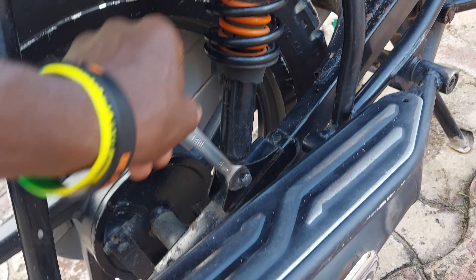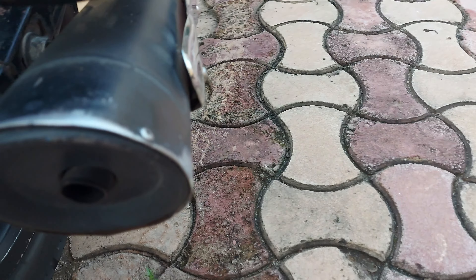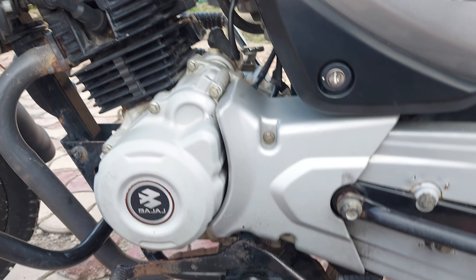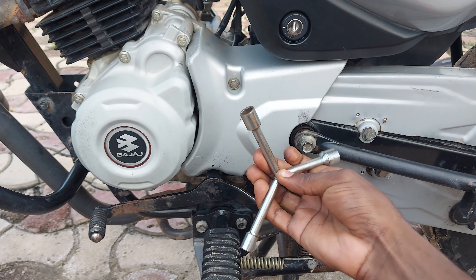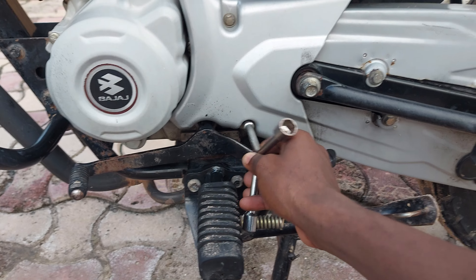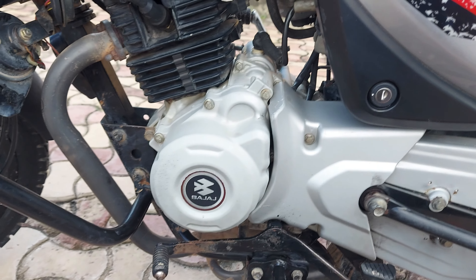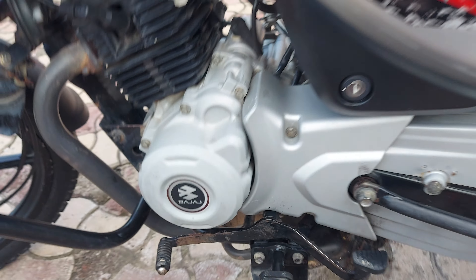Some of the tools here are shared across most parts of the motorcycle. If I want to adjust things in the engine part or gearbox area, the 10mm comes in handy. To remove the sprocket cover I use that one — it fits here and here very nicely. To open the gearbox cover I can use it as well. Most parts here have almost the same spanner size. To adjust the steering bar, I use this one too.